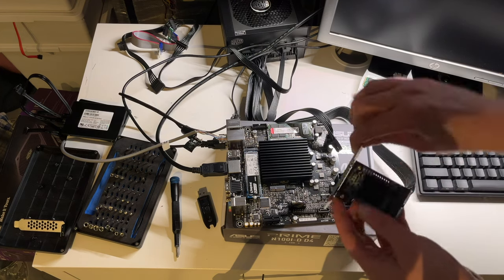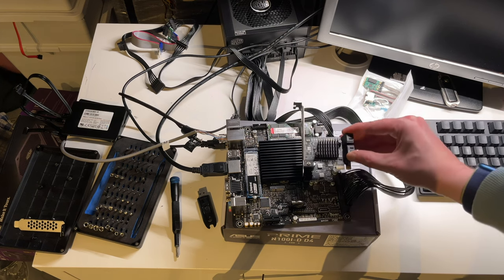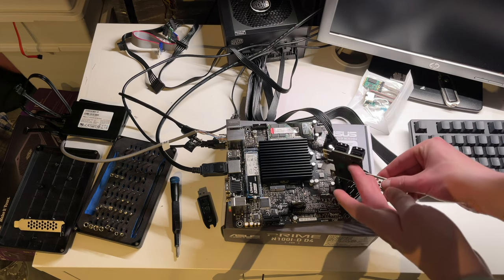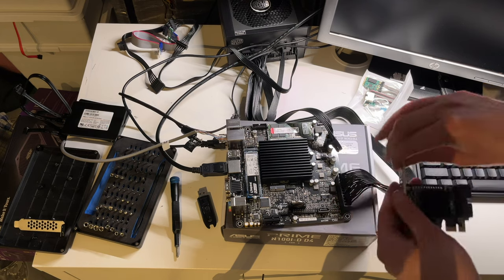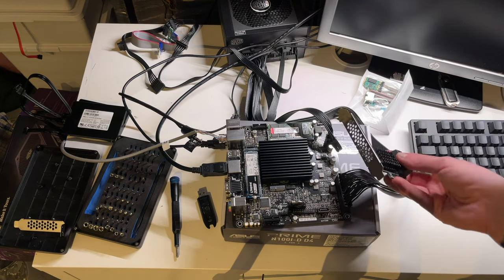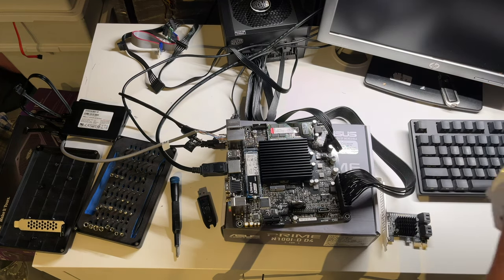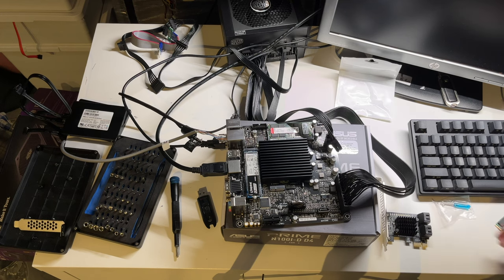What we can see here is just a basic SATA controller card — it is very very black, probably some kind of J-Micron controller on there. This will be running just two hard drives, nothing spectacular. The more interesting item is this 2.5 gig card. It has a Realtek 2.5 gigabit controller on it — the same Realtek controller I'm running in the other server, the one that this board will be put in. I also used it in my test server for a good while.